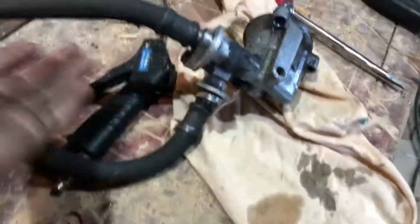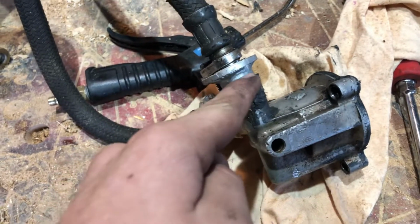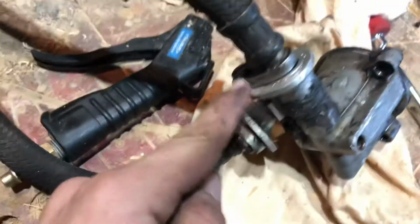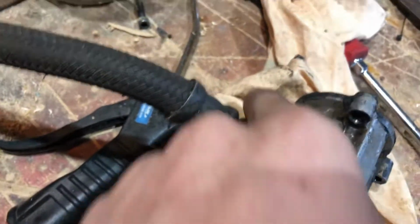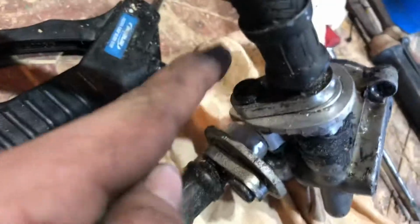And then also on the oil fittings, the dreaded oil fittings that have been giving me a hard time this entire build, I've gotten mostly figured out. So I turned this one on the lathe. It is just threaded into here, and then has that piece of aluminum flat stock on the top that has been aluminum welded to it, that then the fittings on the oil cooler can pop into and bolt down.